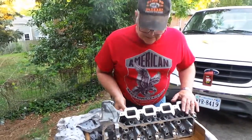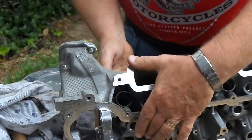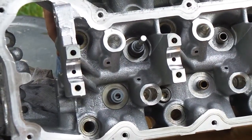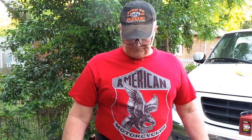Once the seal is on good, you can place the valve back in the hole. You can see the valve coming through nice and tight — that's what you're looking for. That's how you do a valve stem seal — that's all there is to it. All of the seals are the same size, so you can't mix up the exhaust with the intake. It's pretty simple and straightforward. Subscribe because we do killer videos, and next we're going to show you how we attach the valves. Peace out!